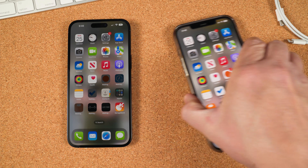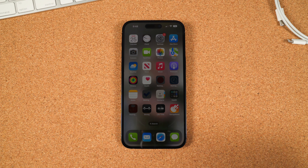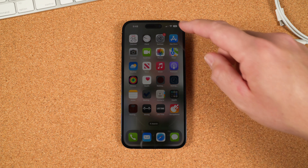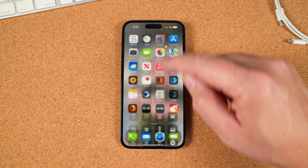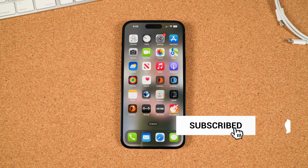Now that our new iPhone is set up and ready to go, give it a bit to download and update any apps it needs to, and you'll be good to go. You can test and confirm your cellular connection by swiping down from the top right and turning off Wi-Fi, if it's turned on, and making sure that everything looks good there. If you notice anything going on with your iPhone's screen brightness dimming and not coming up, you may need to do a quick restart — this is what fixed it in my case. Press and hold the button on the right and then either volume button on the left until the power screen appears. Slide the slider at the top to power off the device. Give it a second, then press and hold the power button again to power back up. Once you unlock your phone, swipe down to get to Control Center and you can increase the screen brightness again.